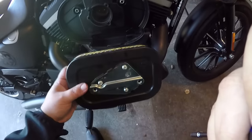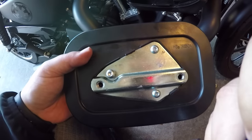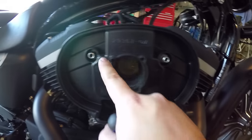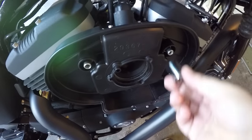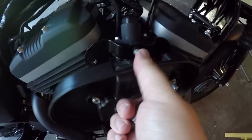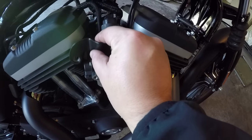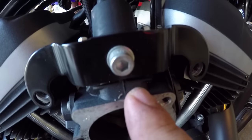That pulls off just like that. Note that those screws are not retained — they do come out if you press them through, so don't pull them out all the way. At this point you're going to need to take out the breather bolts, which are here and here, and that requires a socket. Traditionally you want a deeper socket, but I was able to make this one work. That entire piece comes off just like that. The little bracket piece remaining will also take an allen key or hex bit.